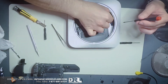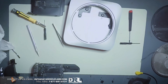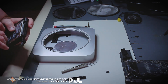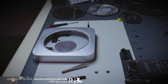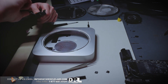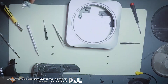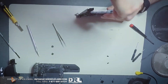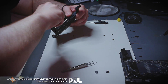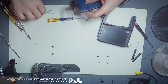Now we can remove the drive tray — both hard drives are on this tray. It looks like a Hitachi hard drive. Just a few more screws on the caddy and the drive comes right out. Now I'm just going to pop the ribbon cable off the SATA connector and here's the drive.